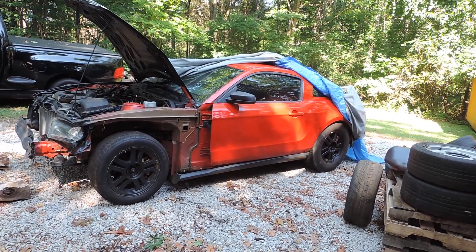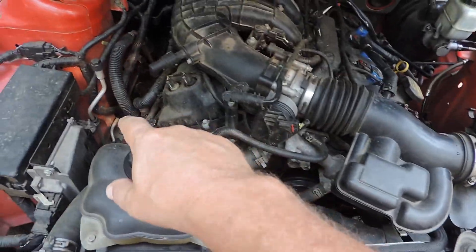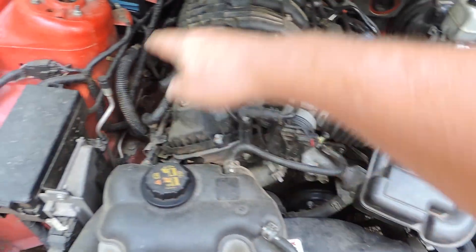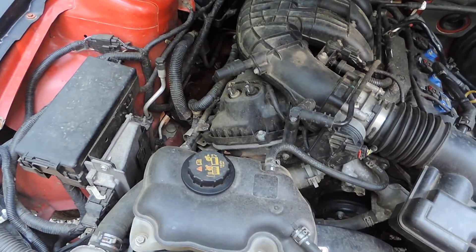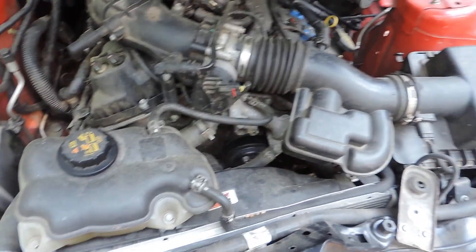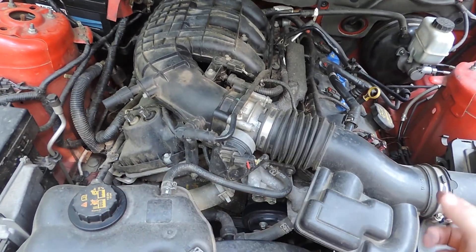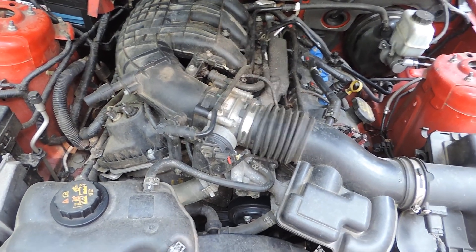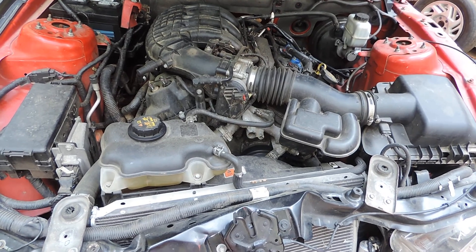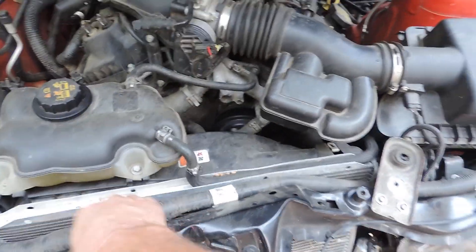I've started assessing what all needs to be done. Some of the more obvious things are that the air conditioning compressor is on this side in the 2012 and it's on this side in the 2007, so even all the air conditioning hard lines are going to have to be swapped. Probably the fuel lines from the tank are going to be different, as the fuel rails are obviously different. But fortunately, these are both S197 cars, and the actual structure of the engine compartment is the same — they actually use the same K-member from 2005 through 2014, I believe — so the K-member should swap over nice, and again giving me the EPAS, bigger brakes, bigger sway bar. Hopefully you can swap that whole thing as a unit, and then it's just a matter of going through this lovely wiring harness.